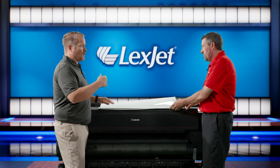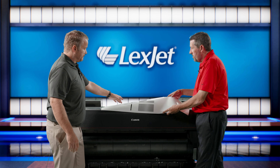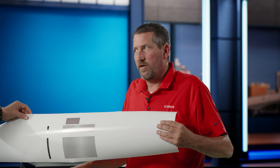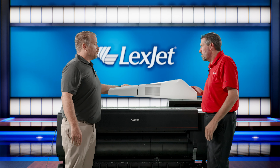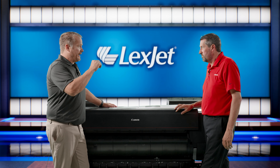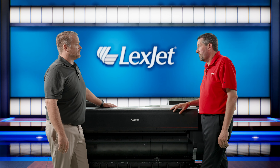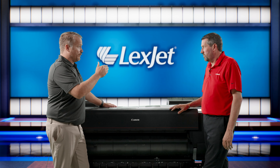So let's talk about the other setting - print quality. The print quality adjustment works a little differently. This one is all done automatically. You print it out, tell it to do an auto adjust, and it prints out information with a lot of fine lines and gradations. It reads all of that and adjusts for the quality of the print - that's what gets our banding back in play. Similar to a calibration target, you don't need to do anything manually. It knows based on what it sees whether it needs to adjust for gap banding, where there's a small gap between lines, or overlap banding, where passes are printing too close together. It reads itself and makes adjustments automatically.